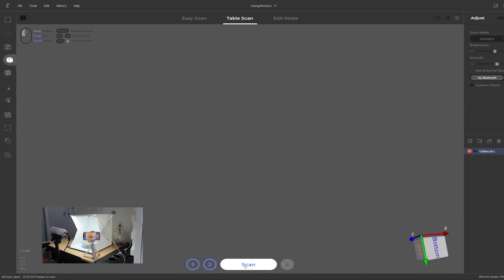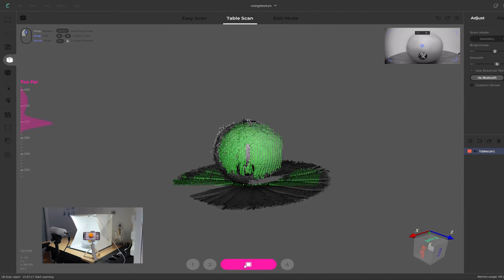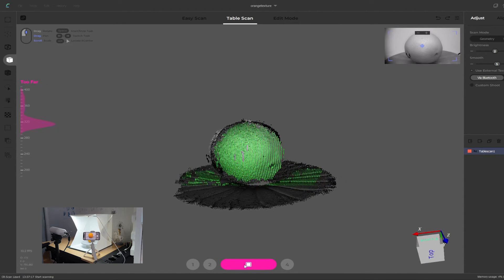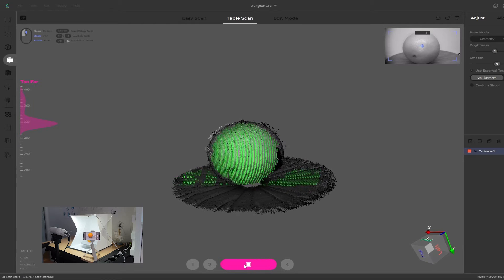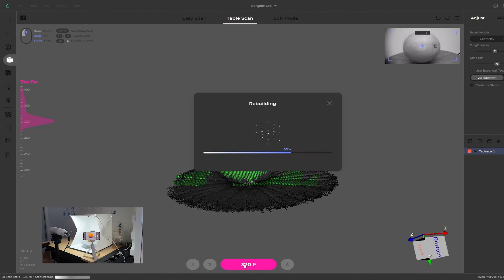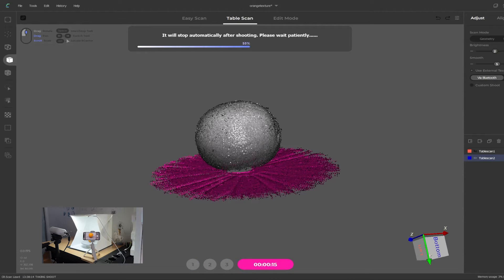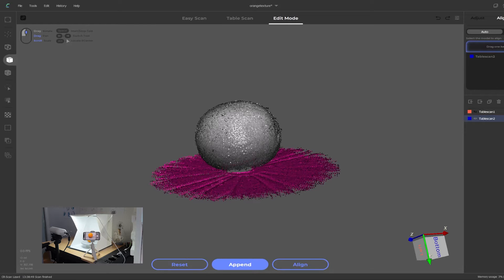Tap on the phone again to keep it active, then click on scan. The sticker helps here — we have three points to orientate when we align: the top, the bottom, and the position of the sticker. When scanning symmetrical objects the software can be confused trying to match geometric patterns, but with the sticker we can manually align it ourselves quite easily. Then take the next set of photos by clicking on shoot. Try to do two scan layers; anything more takes far too long to process with texture mapping.